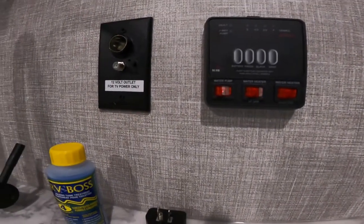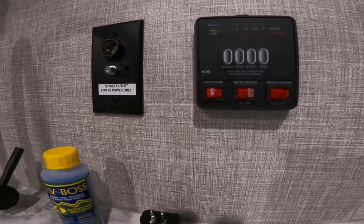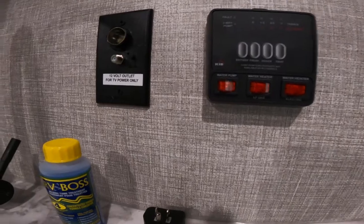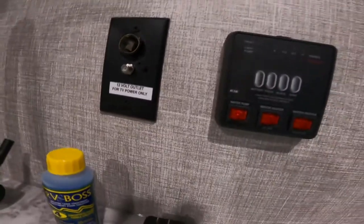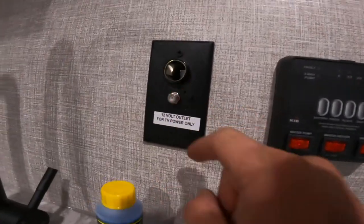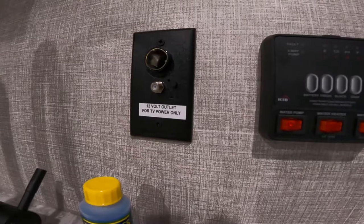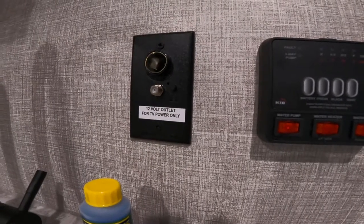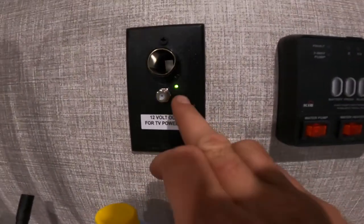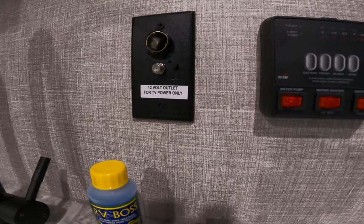Moving over — as I mentioned before, a 12-volt plug-in will allow you to view your cameras, the side view and rear view cameras, if you chose to purchase them. There is a 12-volt plug-in here that the head unit can be plugged into. There's also a connection point for a TV, and this TV connection point is equipped with a signal booster. If connecting your TV to cable or satellite, always make sure the signal booster is off. When the green light is on, the signal booster is on — it is for your antenna only and interferes with your cable or satellite signal.